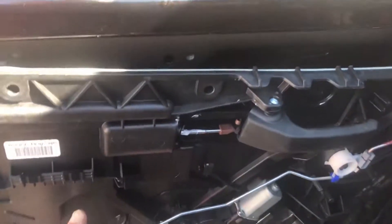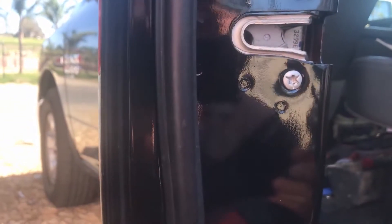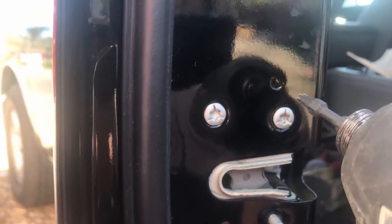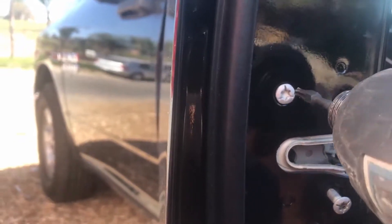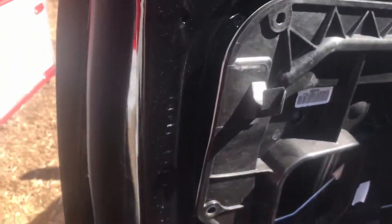I've been able to release the panel. One thing I found: it's best to lower your window so the mechanism goes down, allowing you to pull the panel out. You'll also need to remove these screws — they have a very specific screw head, but a T25 star bit fits in there and takes them out quickly and easily. Once those are out, the door panel should come free.